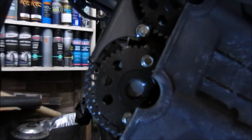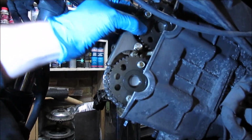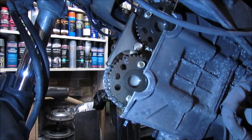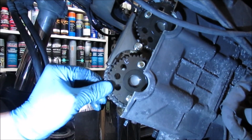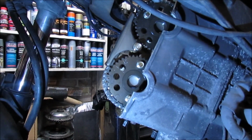That rear sprocket, or rear camshaft, is moving. The front one's not doing anything, but that chain is definitely loose. Right, let's try again. Right, so I'm hoping that is just a tension unit failure, which a lot of you actually said it could be the front cylinder. But so that's definitely raised massive amounts of play, and the timing could be slipping. At this stage I'm hoping I haven't snapped the camshaft.